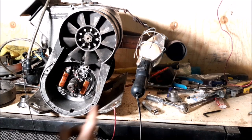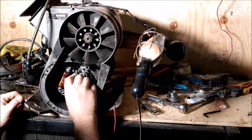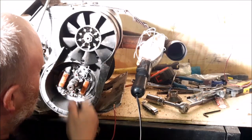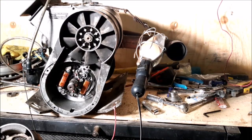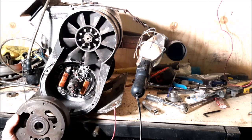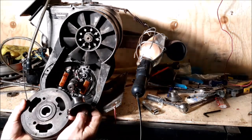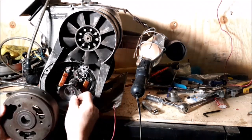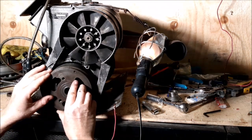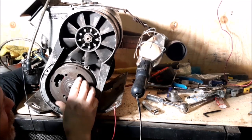I'm going to turn this light on — this light is on dim. I'm going to put this little cam in here. I've got to roll this key to the top on the crankshaft and take a look to see where this flywheel goes. So this flywheel — the key is at the top. I see the window opening here. That window opening has to have this little guy in it to work. So since the key is at the top, this window opening should stick through about there. Now let's slide this on there and find out where that goes.